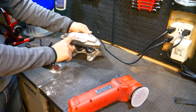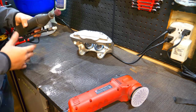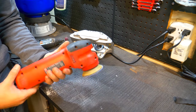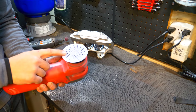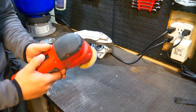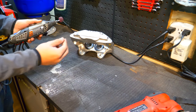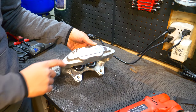We're going to refinish the surface to make it nice and smooth. To get that done, you can use two things: either a Dremel with a bit appropriate to cut down aluminum, or a random orbital polisher with a pretty aggressive disc on it. This is a 180 grit disc that attaches on the backside of the dual action polisher. You're basically trying to smoothen out all the rough marks you created when shaving down the actual material of the caliper.